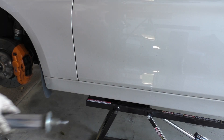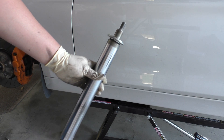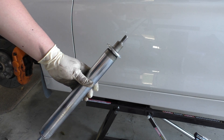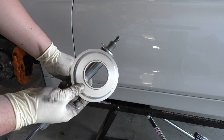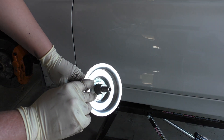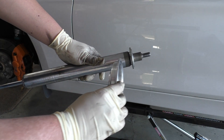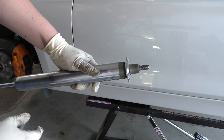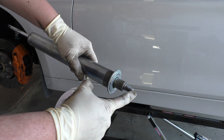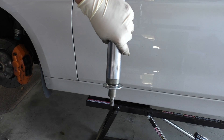The next thing you'll need to do is remove this upper plate from the damper body. The reason why is that to use the 60 millimeter adapter from Millway it doesn't quite fit over that, so we need to remove it so the adapter can freely move up and down on the shaft. The way you do that is support this end with a block of wood and then take a hammer and just hammer it until it pops off.